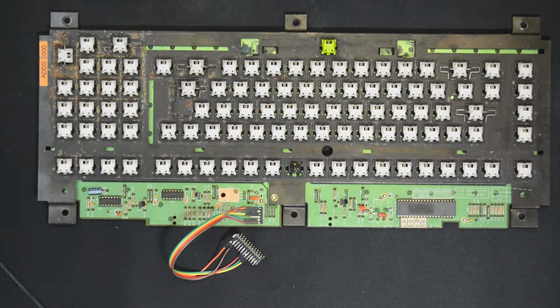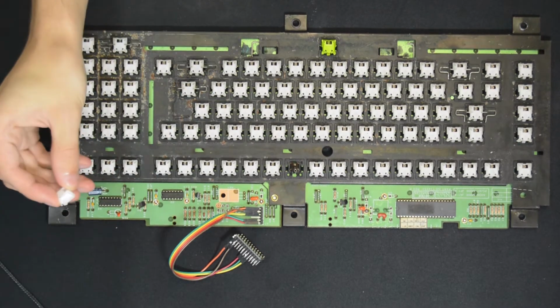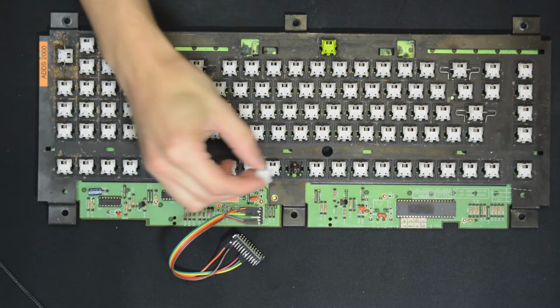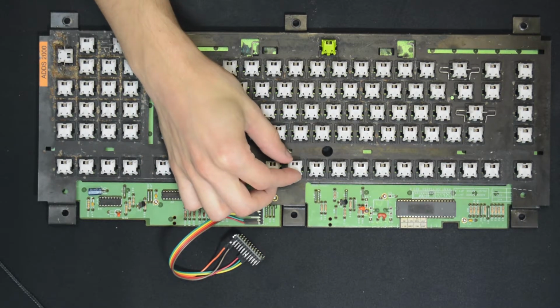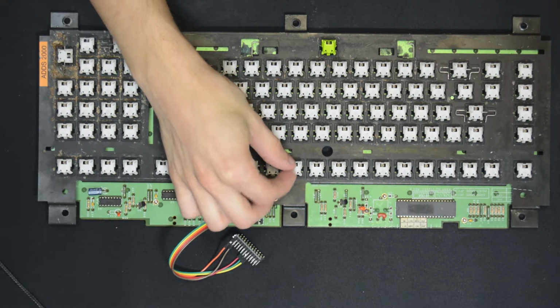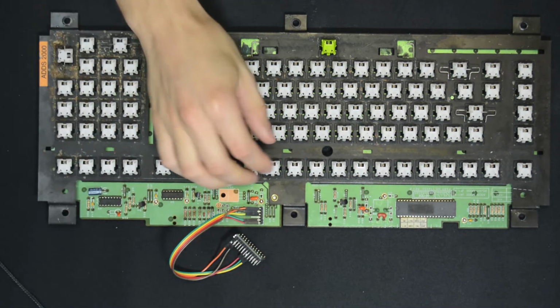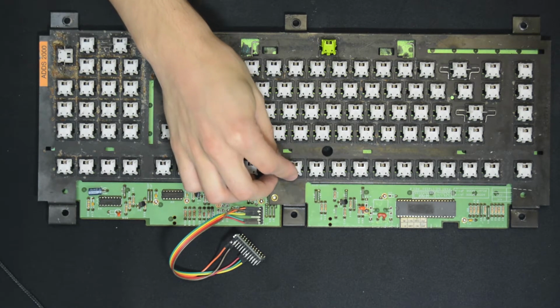So to reassemble the switch, all you need is your finger and the switch slider itself. So you have the spring in and the contact leaves. You want to make sure you place the switch over the contact leaves and the spring, wiggle the hands apart, and then use your index finger to push straight down like that, so both click, and now the switch operates properly.